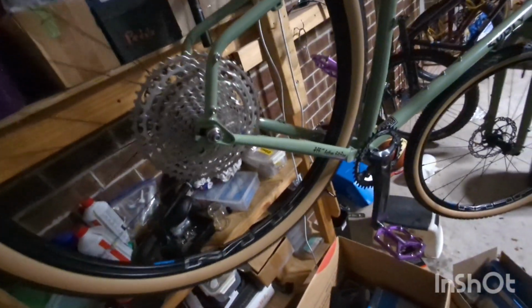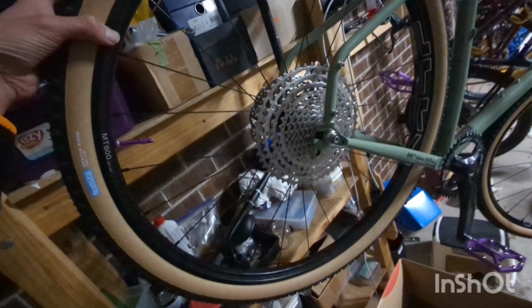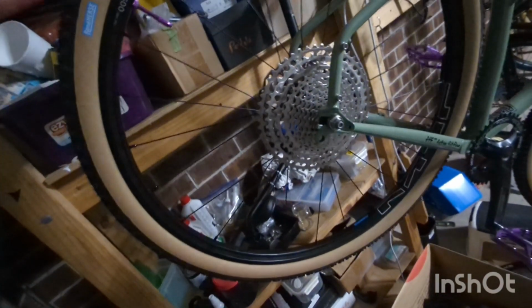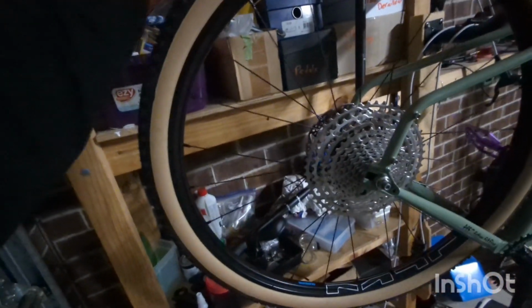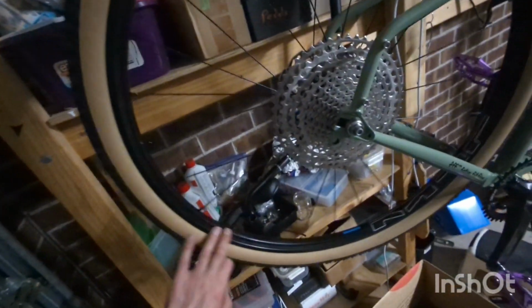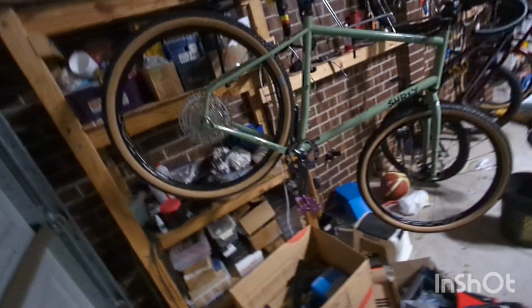I used the inner tube, and that made it basically easy. What the inner tube does is it basically seats or beds the tire, and then if you leave it for a day, you take the tube out. What you do is you just pop the tire off from one side of the rim, and what that means is the other side is still bedded or stuck on. So if you do it carefully, you obviously have to be gentle about it, so you don't pop the other side off. But anyway, I did it, and both times I managed to get them to pop on.